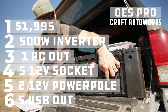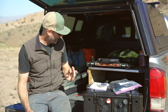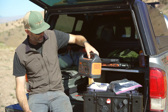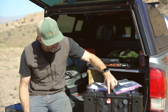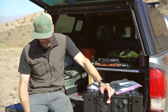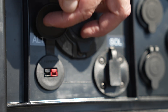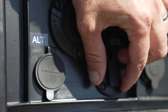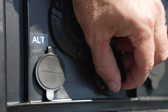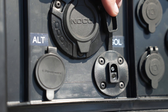It's got five USBs of varying outputs in the middle. It's input heavy — where other batteries like this Jackery have one input, this has three: 12 volt alternator charging from your vehicle, 110 volt shore power, and solar. You can have all of those things plugged in at the same time without switching things in and out.